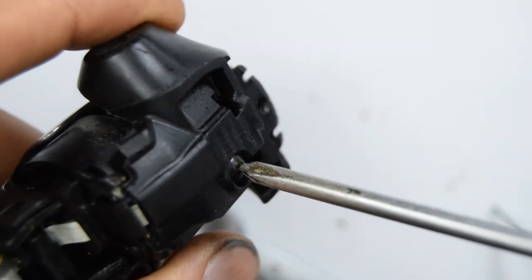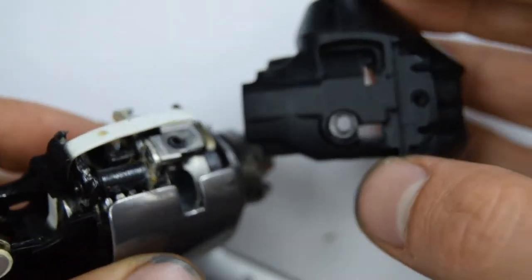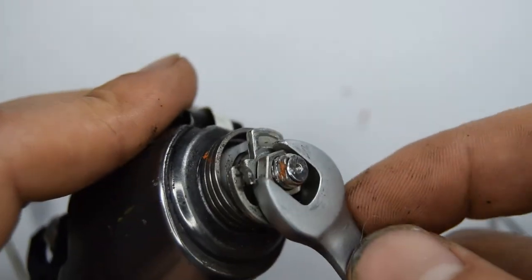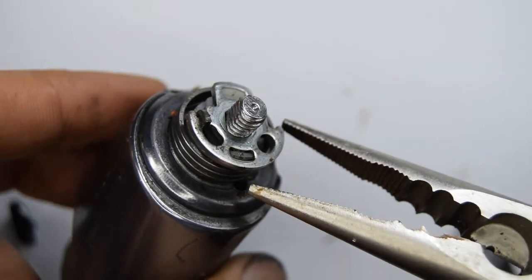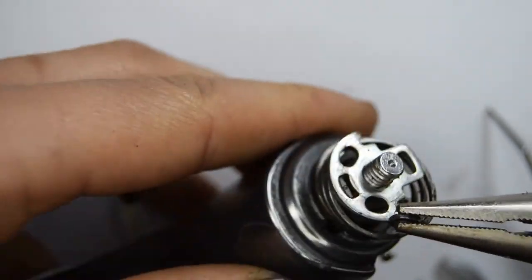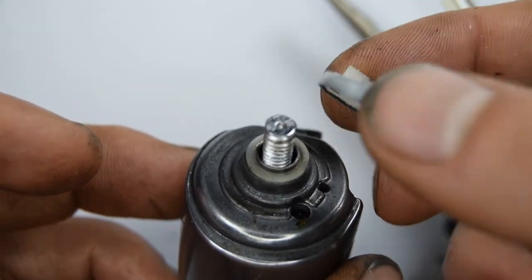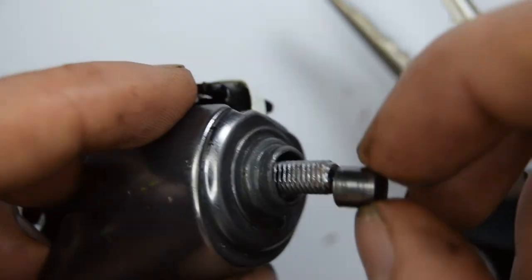Still stuck so we're going to remove this screw on the top. That worked - it was just sticky. So we've taken off the first cover. The top here is again a number 8, and it's just anti-clockwise to remove. Now we can remove this plate. There's a tip of a spring here to remove - that was quite tensioned. Spring removed and this plate has a plastic bushing part. There's another plastic nylon bushing that was inserted in here - a little bit of a sleeve.